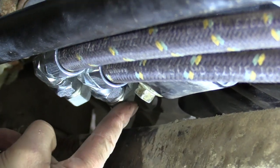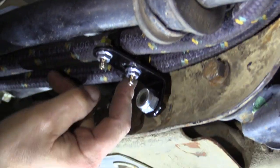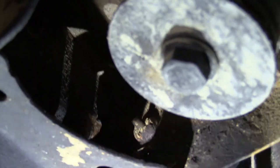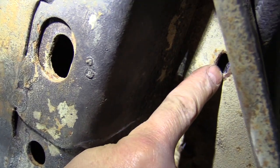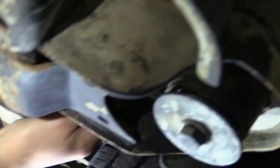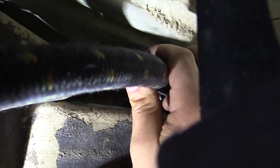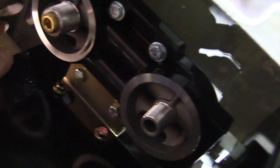This one right here is the dirty oil coming from the engine; this one here is the return oil. I'm going to show you the routing — tracing this dirty one. We're coming up above the cab mount on the frame. We've got a hole right here on the bottom of that cab mount — we're going to use that for clamping the hoses to that frame. We've got about a good inch and a half there from the tire — I've got the wheel turned as hard right as it'll go. This sway bar is going to move very little, so that shouldn't be an issue. We're going to put on two clamps right up here. The inside hose here is the dirty oil — it's going to go up here to this port. That port corresponds with your oil sample valve back here — we've got that plug out and we need to put that valve in there.